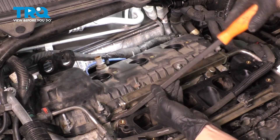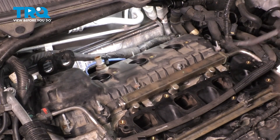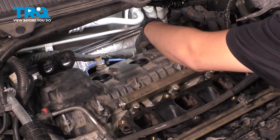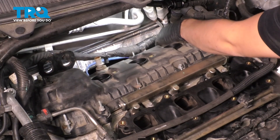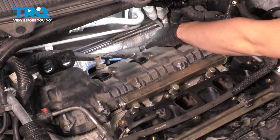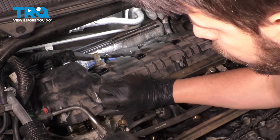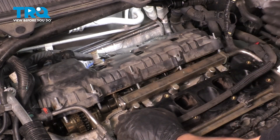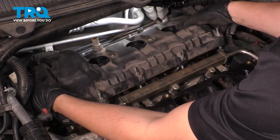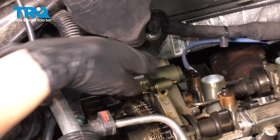Best way to do this is to give it a couple of wiggles — a lot of times you can get it to break free like that. If not, do some very gentle prying. That corner broke free — try over here, and over here they don't give you much to pry on. Be very gentle — you don't want to break anything. If you have a lot of debris here, make sure you clean it up first. Get everything out of your way and slide the valve cover up and off. We're replacing the intake solenoid — use an 8mm socket to get the bolt out.